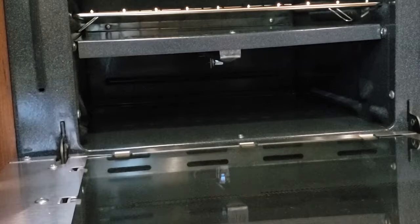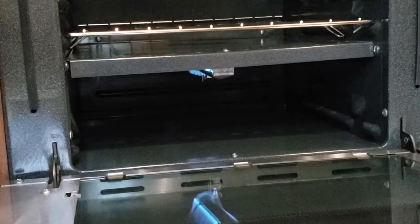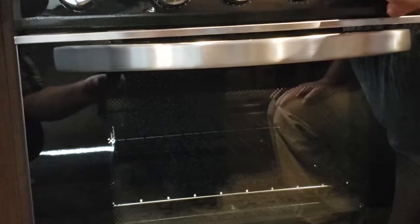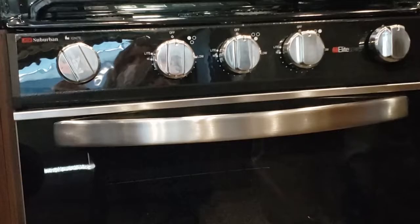There's your burner. This is up high enough that if you bought a broiler pan, you could broil on the bottom since the heat's above you. If you think you're going to reuse the oven throughout the day, you can leave the pilot on so you don't have to light it each time. But if you're done and taking off, just turn it off — it saves propane.